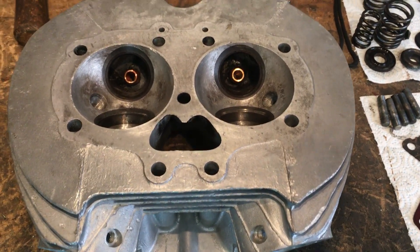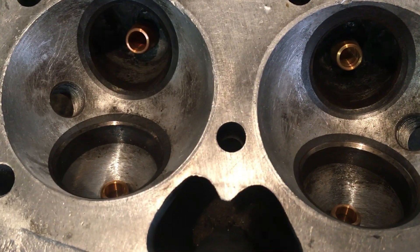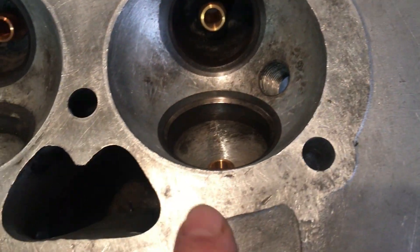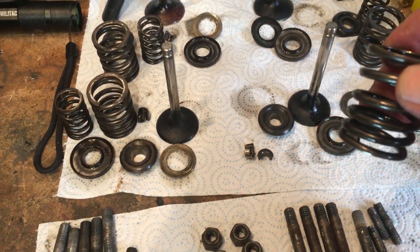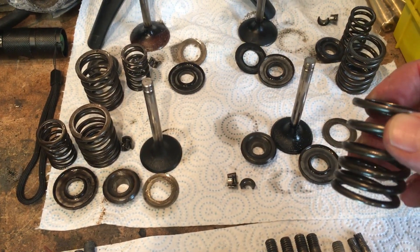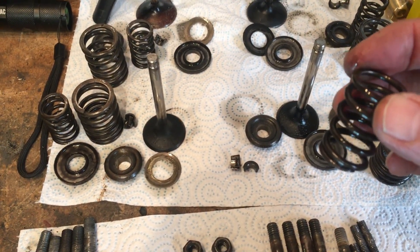A couple of things checked first. I've checked the mating face with a straight edge and it's not depressed in the middle - not perceptibly. You can actually see the original skimming marks which is good. The second thing I've done is checked the free length of all the springs. The long ones are a tiny bit shorter than full length, maybe about a millimeter, but that's not too bad out of 44mm. The shorter ones haven't compressed at all - if anything they're a little bit longer than published. So I'm going to go with those.